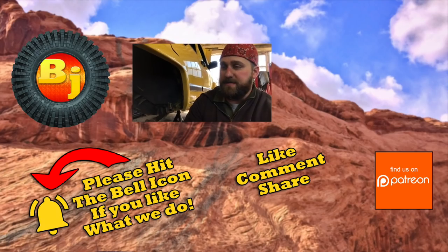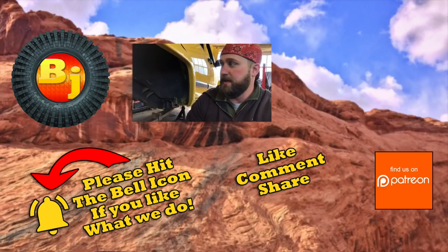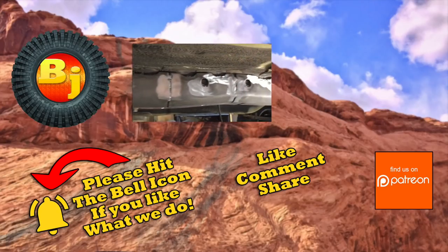Another tip too — the exhaust on mine was out, which I realized on the passenger side made a huge difference for clearance. If I'd had the exhaust tubing in there at the time, it would have been pretty difficult to get the clamps on there. And on the driver's side you've got the fuel lines, so be mindful of that — be very, very careful. It did help to take the wheels off just to get some more light in there so that you're not struggling with visibility so much, especially on the front where you have that little wrap-around piece. Take the front tire off. If you're jacking up the vehicle though, do be mindful that you're not twisting the frame. You wouldn't want to have this all twisted up and put the frame stiffener on in a way that would have your frame or body tweaked.